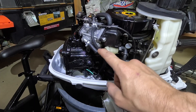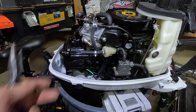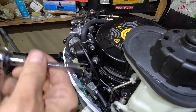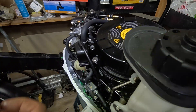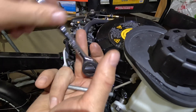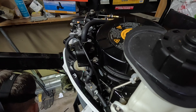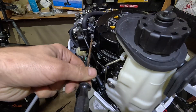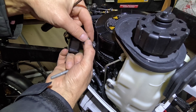First, we'll disconnect this fuel hose from the carburetor — just push this thing down. Then we're going to remove these two big bolts; they're the main ones holding the carburetor. I'm going to use a 10 millimeter socket. Once the first bolt is removed there's more space for the second one, otherwise it's kind of difficult to remove that second one on the side. You can finish unscrewing it with any type of screwdriver.